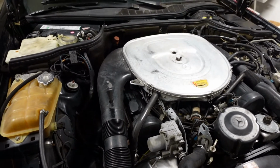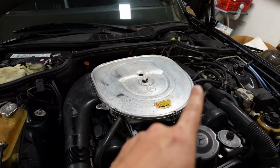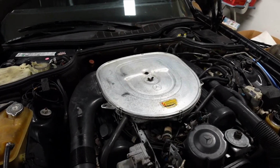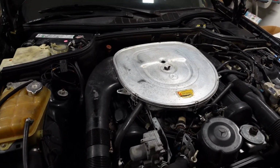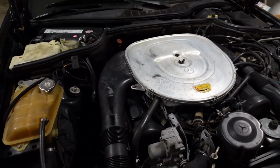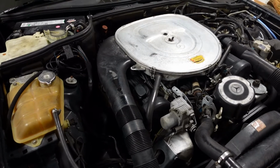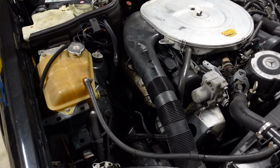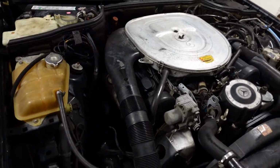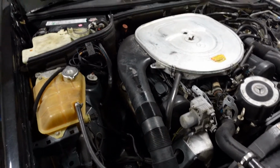I know it has a lot of catalytic converters on it. It has a single exhaust and a small crossover pipe that runs from the left to the right. And I believe that diameter is only 1 5/8 inches. So all the exhaust from one side of the engine has to cross through that small pipe. And finding the headers that came on some of the European spec cars is almost impossible. So maybe one day I will fab something.